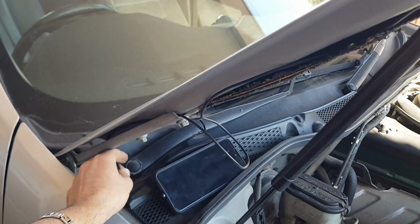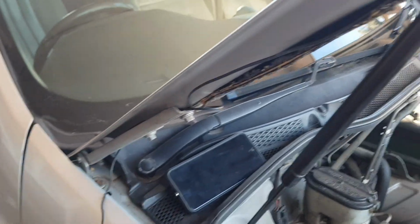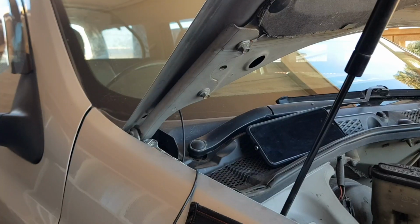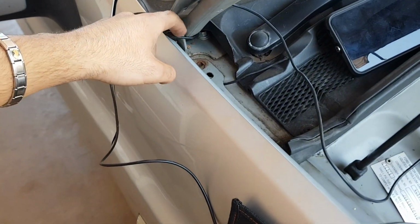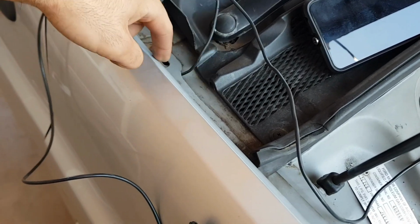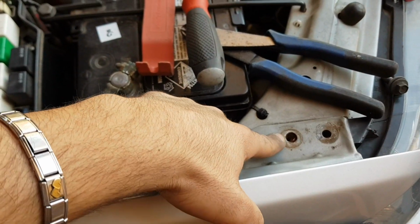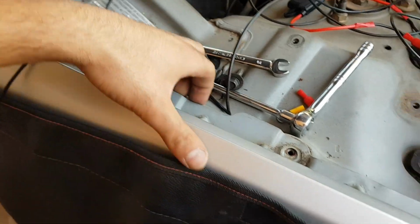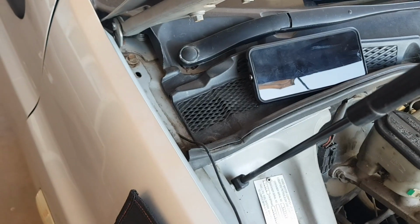Now, to make it as clean as possible, I go and remove any of the excess before this hinge section here. Now, with the positive line tucked cleanly behind the liner and around this section of the hinge, we can go through and tuck it underneath the actual guard. So to do that, if we open this bolt here, there's another bolt in the middle, a bolt here, and then a bolt for the headlight. That'll give us some wiggle room for the actual guard there, and we'll be able to more easily tuck in the cable and route it underneath the guard so it's out of sight and away from the elements.